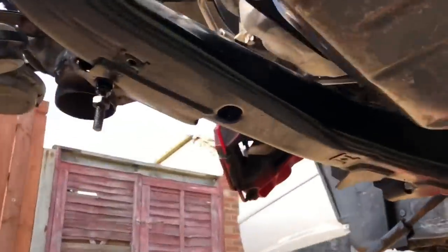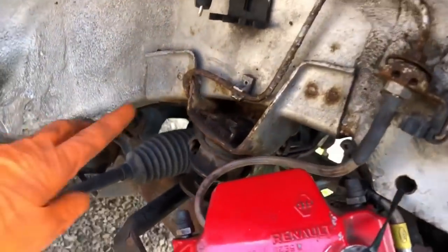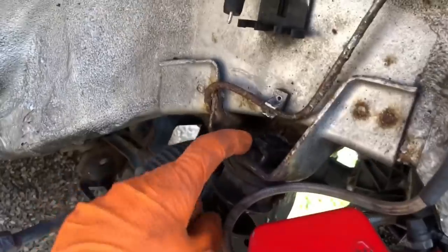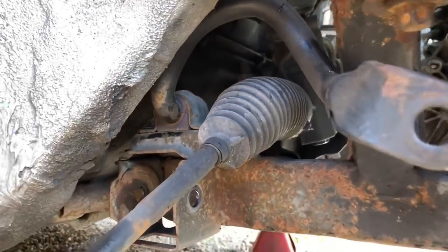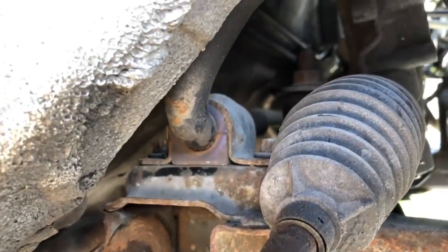Once you disconnect that wiring it just slides down behind the gearbox and you can pull the subframe out. The subframe's pretty much ready to come out — it's such a simple design. Already took off the runs going up into the top of the chassis legs. They always corrode up here so always wire brush them at the top first, get all the rust and corrosion off, soak them in WD or whatever lubricant. On this subframe we're going to replace the anti-roll bar and fit a Whiteline anti-roll bar. The bushes are already Powerflex — the purple ones — I didn't get the black ones.